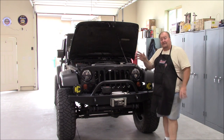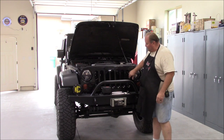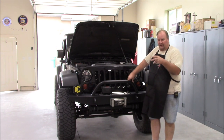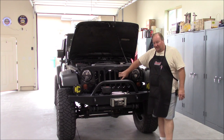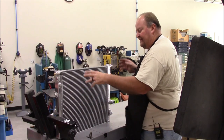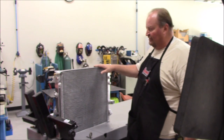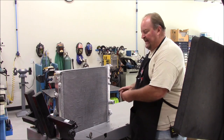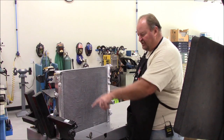It does move more airflow than the earlier predecessor. The problem with these radiators is you've got the standard Jeep grille. I've got a radiator here that's out of the vehicle — it's a Jeep radiator. Let me show you the size. This is an aluminum radiator, basically the same physical height and width as an OEM Jeep radiator with the plastic tanks. This one's a little thicker for more capacity because of my 6.2 liter LS that I'm running. But you still have 22 inches by 21 inches — about 462 square inches of surface area of the radiator.